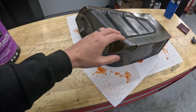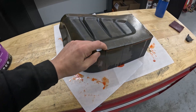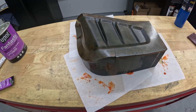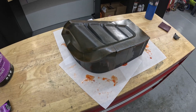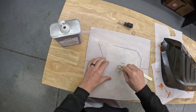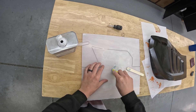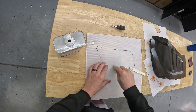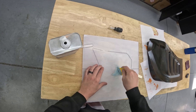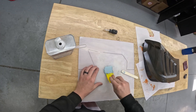I'm going to sand the whole surface down with 120 or 180 grit to get it ready for primer. I'm going to sprinkle a little bit of acetone to make the Bondo even thinner — it almost makes it like glazing putty because of how thin the acetone makes it, but it still has the strength of Bondo. I'm just filling in these things so that when I primer it I don't have to rely on the primer to fill the voids.